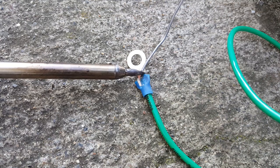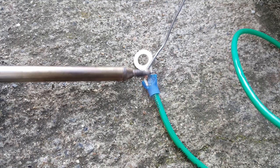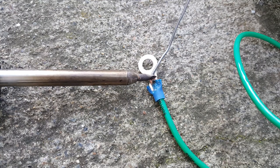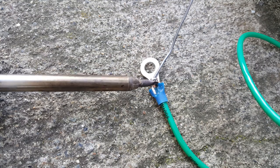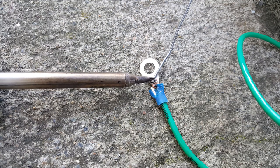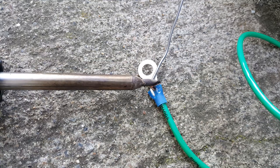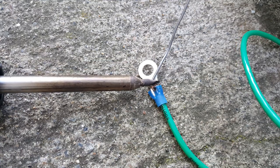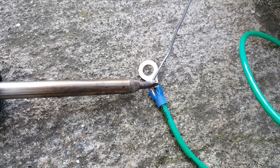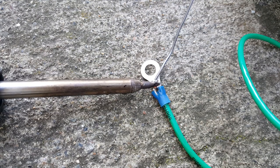You want to get the tip and the solder together. Sometimes it doesn't heat right away but it'll get there. You don't want it to just drip and fall down — you want to make sure it actually flows in. See there — that's a cold solder right now because it's just bulking on there. You can see how the flux attracts. There we go, now it's heating. What I'm doing is heating the wires up and having the solder sip through — it's attracting because of the flux.